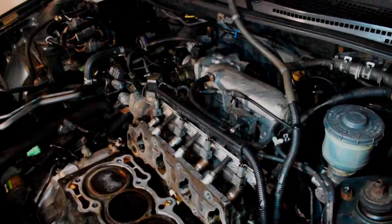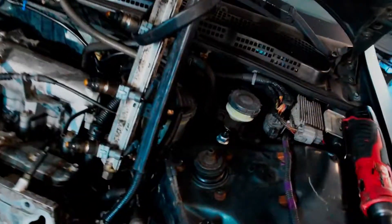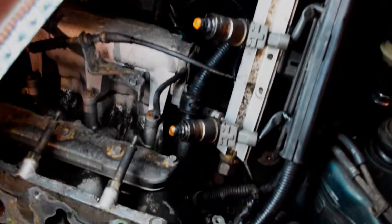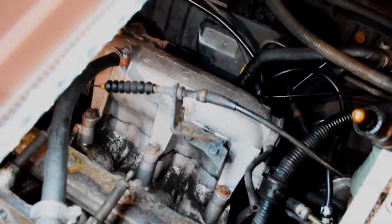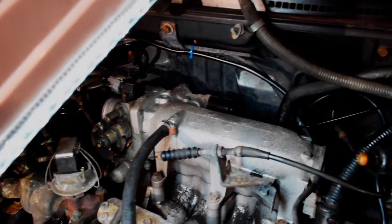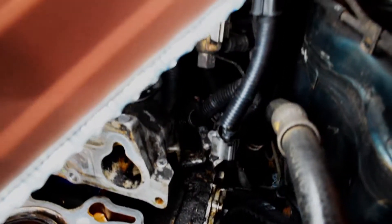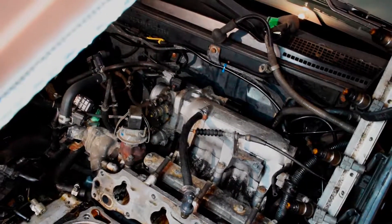I got the fuel rail off and have it bungeed up here to keep it out of the way. You can see those three big studs — there are three nuts on there — and it popped out relatively easily. The injectors do look pretty grimy, so I'll end up cleaning those to improve flow. I'm taking off the bracket for the throttle cable without messing with the adjustment screws, and I disconnected some vacuum lines and a wiring harness that was snapped in with a plastic clip.